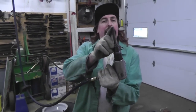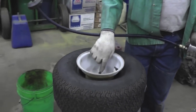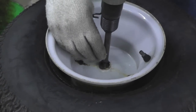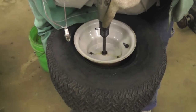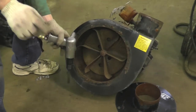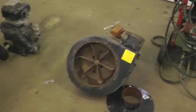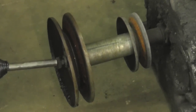First, you need an air hammer with a chisel point — it's got to have a point on it. What you do is put a bolt in there. I already pre-drilled a divot. Put the air hammer on there, get some air, pull up on it, and walk it off. Same thing on the other side — take the bolt out, take the washers off, you might need a longer bolt. Put a divot on that bolt and walk it off. Same with the engine — always have the bolt there, put the air hammer on it, and walk it off.